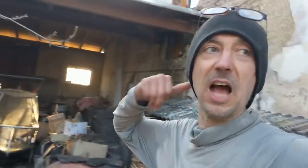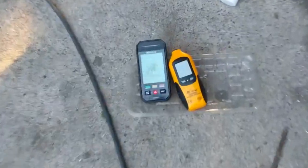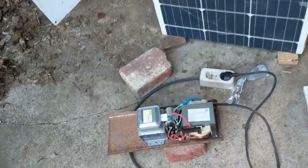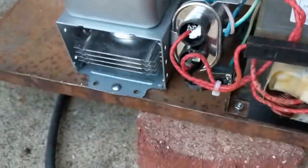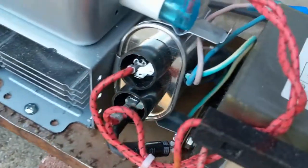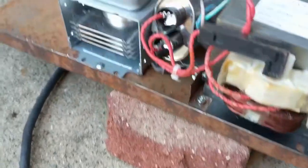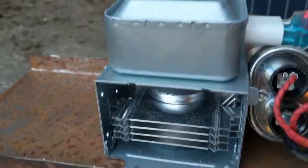And so you see, that's why it was safe to start from a long distance, even if it would not have worked. And since here with the protection go closer. So yeah, it's quite simply. It's just a transformator. Now I must not touch here the capacitor, because the capacitor could still have a 2000 volt. That's dangerous. And yeah, the magnetron.